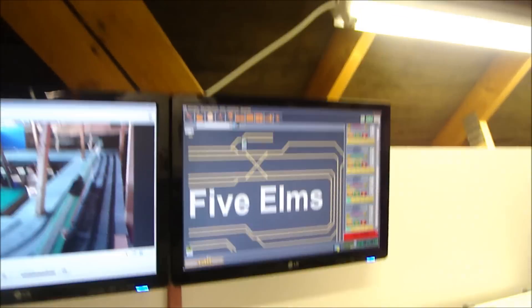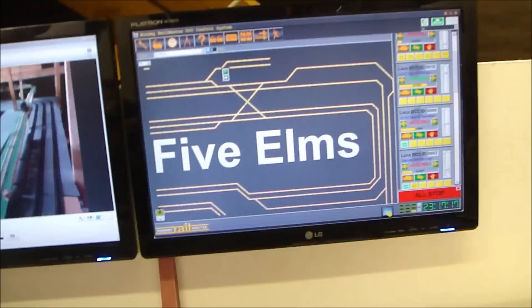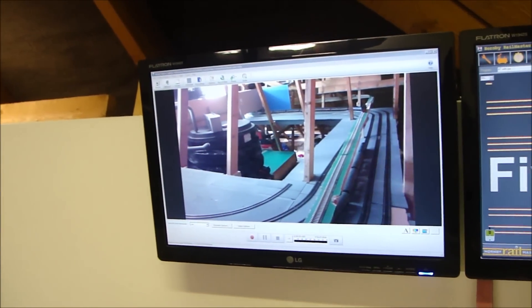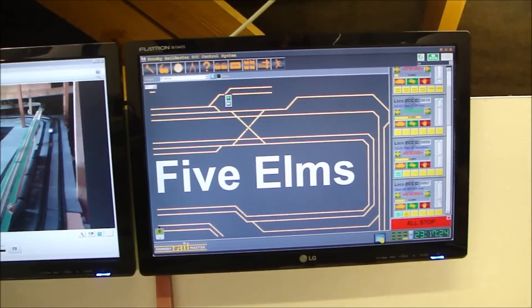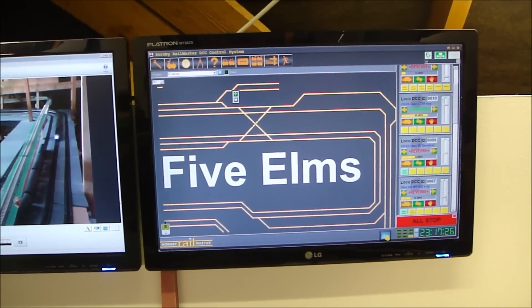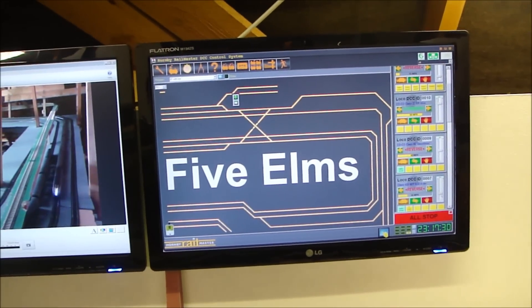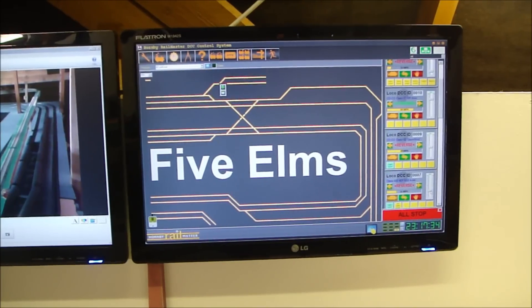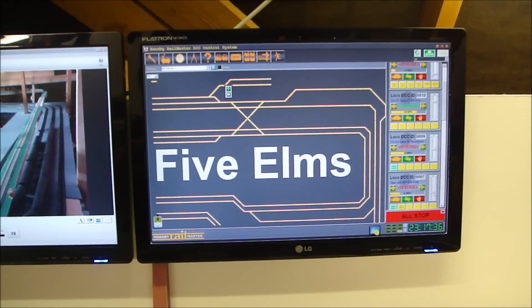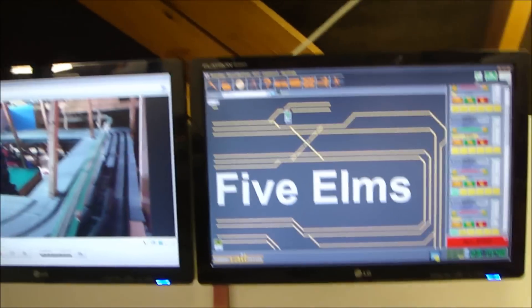The only real issue is that, for example, after I installed it, I also installed the webcam — both being on USB, it pushed the E-Link down to a different COM port. So the computer couldn't find the E-Link controller. You have to go into device manager, find out what COM port it's on and change it. Not hard for some people, but a nightmare for others. So installation isn't easy.